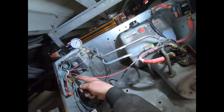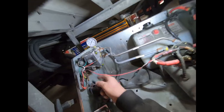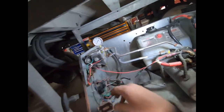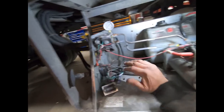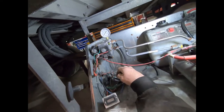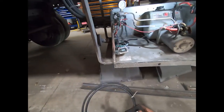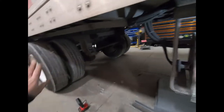All the control switch wiring is controlled by this — it's a 15 or 20 amp breaker right here. You can see this gets tapped off of the bus bar from the battery box that powers the motor. This 20 amp breaker goes out to the control switch wiring, so if you ever have an issue with the control switch wiring not working at all, check this breaker first. I like to get a brand new switch here because I can bypass any wiring — I just unplug it and put a brand new switch on, bypassing the extension cable, which makes it easier to troubleshoot.